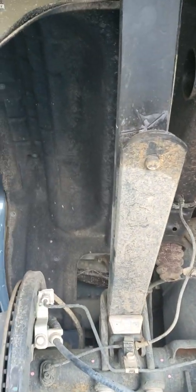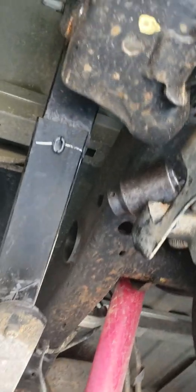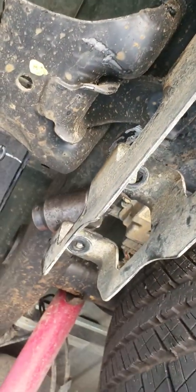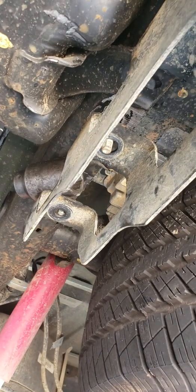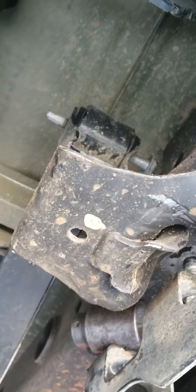The operation was called for taking the spring completely out, but I didn't — I'm trying to cheat it a little bit. I just took the bed bolts out. Just remove all the bed bolts except the last one, just loosen it a couple rounds, and raise the bed up far enough to get the top bolt on that shackle out — they give enough clearance — and you won't have to remove that spring just to change the shackle.